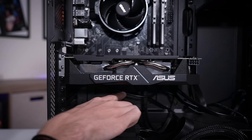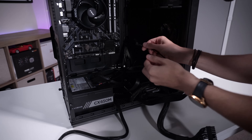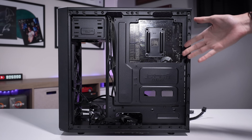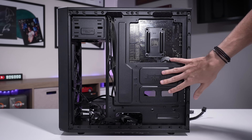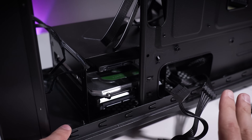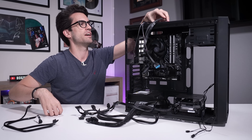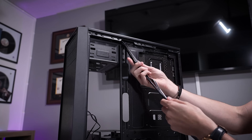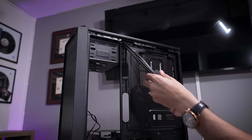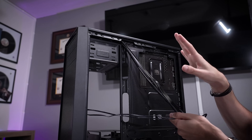The 24-pin needs to come out, and we've got smaller ones under the graphics card. To make things easier we're going to remove the card outright so that we can access everything better. Also just realized these two intake fans were not wired up, so we'll take care of that for the owner as well. Removing the right side panel — it actually looks deceivingly clean back here, but it's just because all the space behind the motherboard tray went unused. We've got just a few extra cables here for an SSD and a hard disk drive. Now everything is disconnected and I've separated all cables by source: power supply cables at the front, SATA cables, front IO cables, and fan cables.